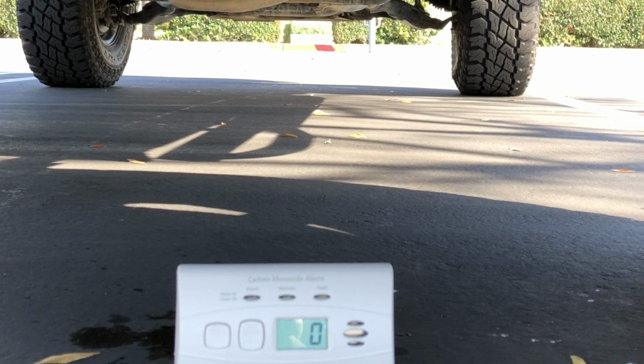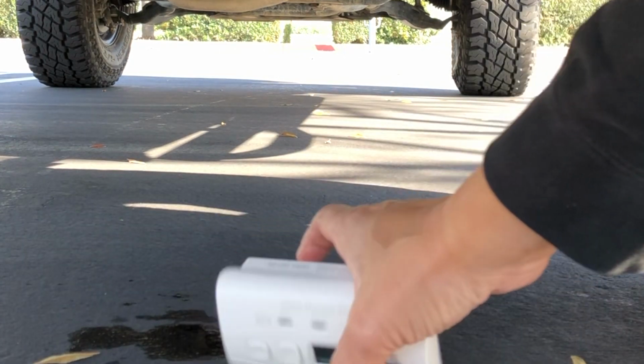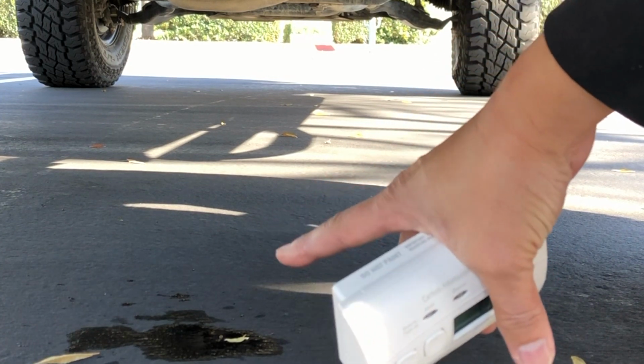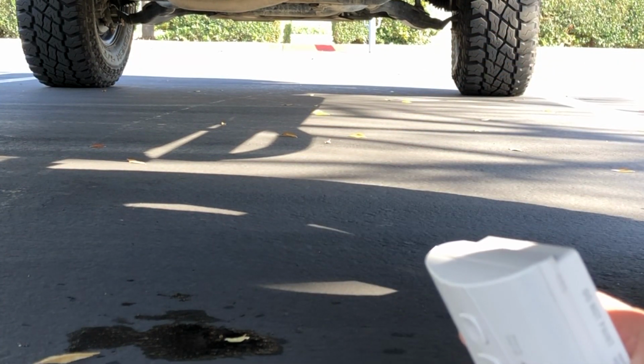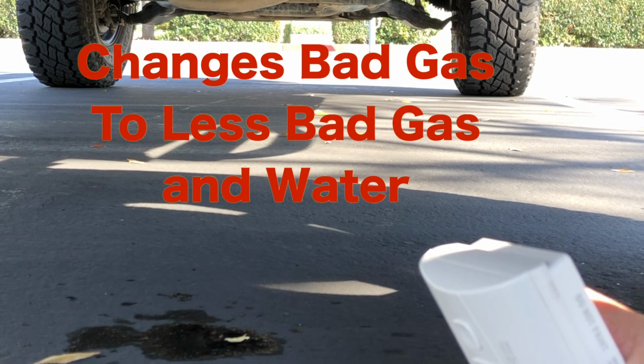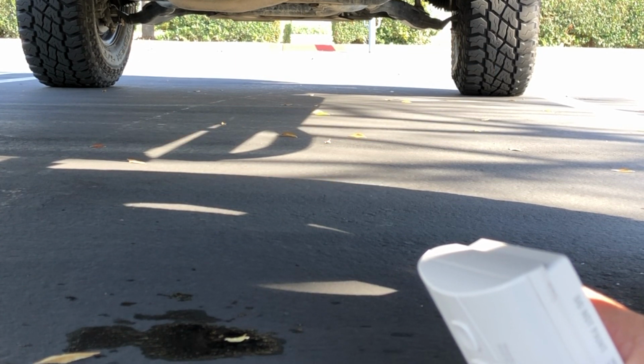So if I had to idle it for some reason, maybe I'm cold or hot and just kicking back, the concern was, hey, these gases are going to sit there and kill you. If you didn't notice here, there's actually water on the ground. Let's see if I can point at it. The water coming out on the ground is actually from the exhaust. The reason is that this has 4 catalytic converters. What a catalytic converter does is try to change the emissions into moisture, or water.